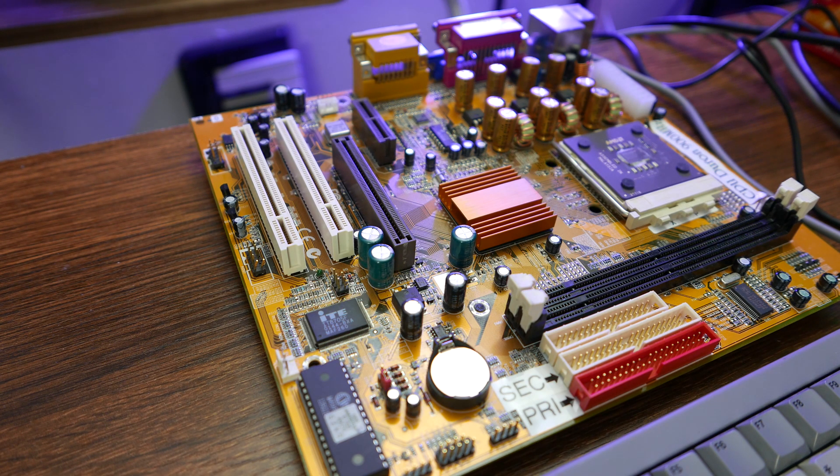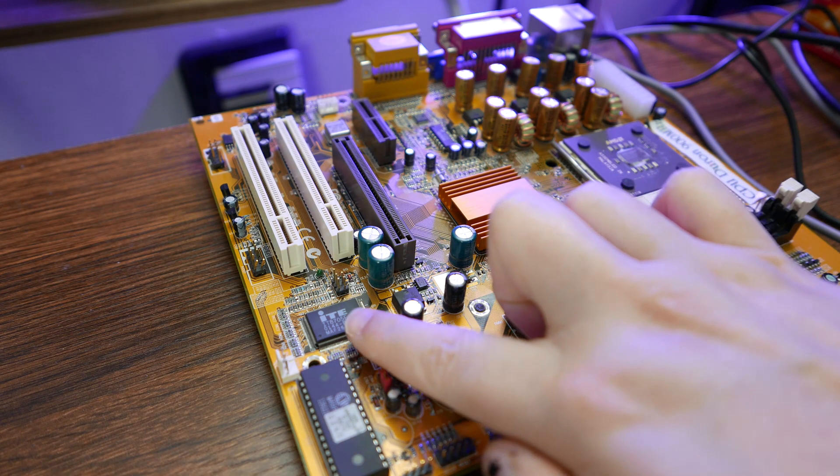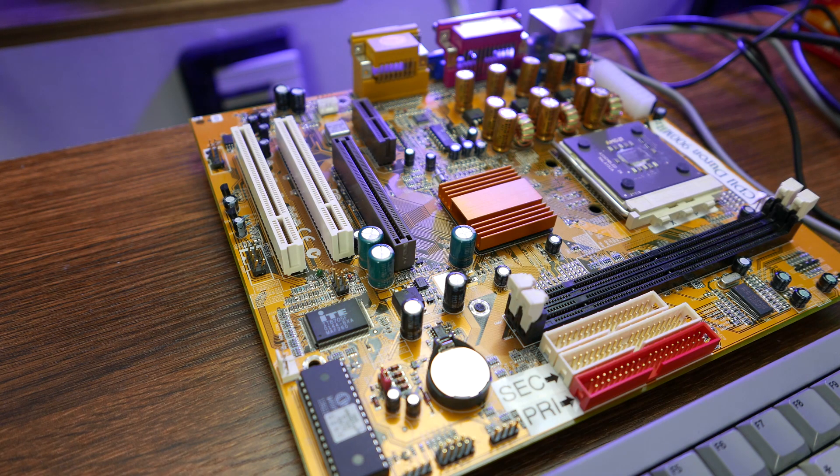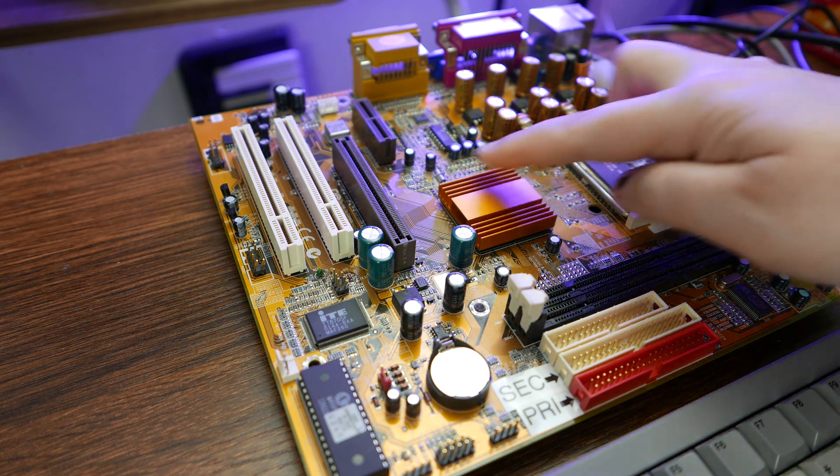The other thing that was interesting to me is that we've got a universal AGP port here. That's not common really on anything, and a really good universal AGP port is one of those things that's going to come in handy for GPU testing, for example. And then the third thing that stood out to me was this single chip for the chipset. This is just a Super IO chip over here — it mostly gives us COM port and floppy connection, and that's about it. Everything else for this board is provided by this single chip in the chipset.